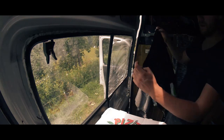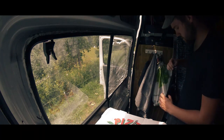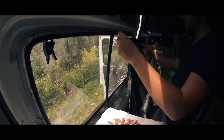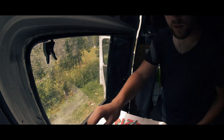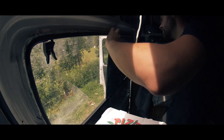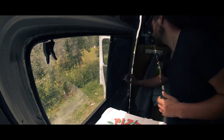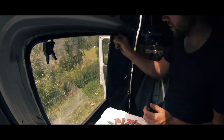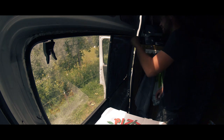And then what you do, take your sheet, the right way round, obviously. Which is like that. Just lay it on at the top. Give it a wet now on the outside so you don't scratch the film. Try not to press this, like, yeah. This is where your spray bottle comes in, because I'm going to end up pressing this down now and getting air bubbles in it. Pretty much there. And you just get your squeegee and you just run it. Start with the top, run it across like that. Go right up to the edge.